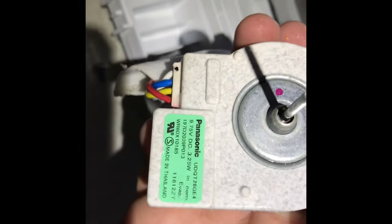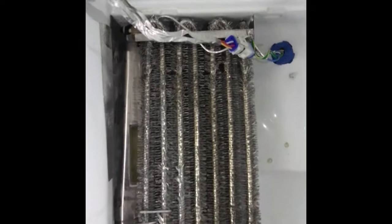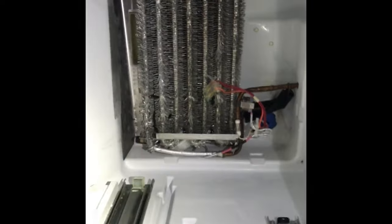Taking this stuff out of the freezer was the hard part. Then you clean up as you go — get all that gunk out of your freezer, make it look good. There is the motor, your little freezer motor — Panasonic. Everything's taken off the freezer just to get access to it. There's the bracket, and you also have the light bulb harness, which will unplug easily — and you'll bend the pins very easily as you figure out how to get that backboard off. Go slow. Do not break anything. Take your time. If something is resisting, do not force anything. You'll regret it because you'll have to buy a replacement part.